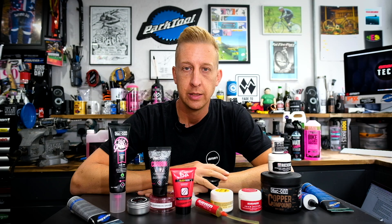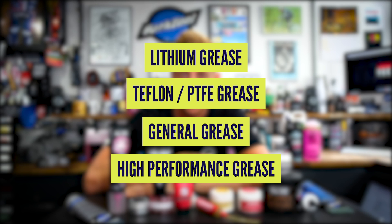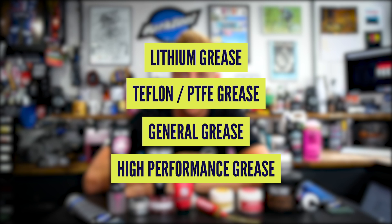Let's talk about grease because there are loads of different options. The main types you tend to see are lithium grease, Teflon grease, generic workshop grease, and high-performance grease. Lithium grease is the cheapest — white or light grey in colour, often seen in big tubs in workshops. It's fine for installation purposes such as underneath bearings sitting into bearing cups and frames, but it doesn't last that long and can turn into a gunk after a while. You don't tend to see it as much in the mountain bike world.